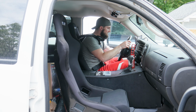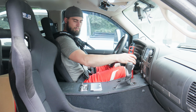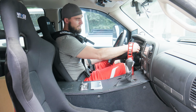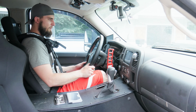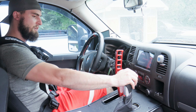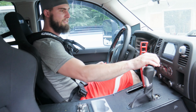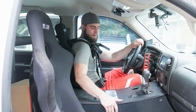Okay, so as you can see, you now have everything hooked up. So this is obviously not plumbed up, but the thing is we added the CB radio into here now. Got the shifter fully hooked up and the electrical wired. Got the old shifter out of here, so this is no longer in the way. So not gonna start the truck up because I've got some parts of the engine disassembled, but hit the brake, put it in reverse, neutral, drive, manual, and then you can go all the way back up into park. Truck locks up in park, or unlocks in park. We're good to go.